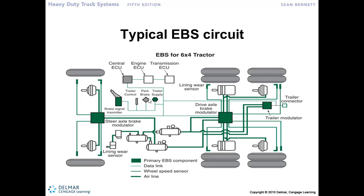The trailer spike control valve, the park brake valve, and the trailer supply valve are just electronic switches. When we push in the yellow push-pull, it's saying release the park brakes on the tractor, and sends a signal out to our relay valve. It's then going to add air pressure to release the spring brakes. Based on the inputs and outputs, it's sending to the EBS ECU, which is also sending and receiving signals from the engine and transmission ECU.